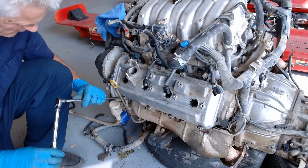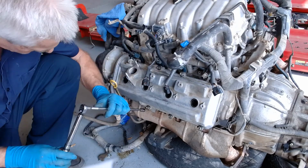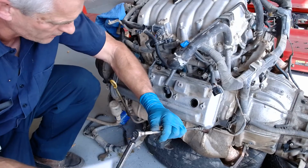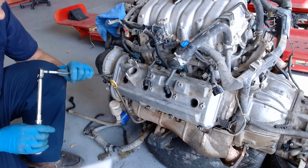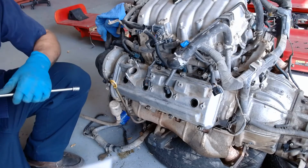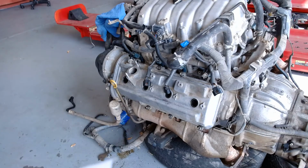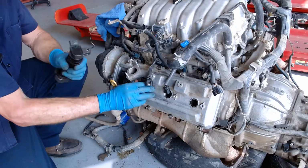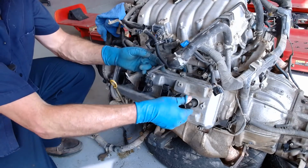So I have to do them again, to make sure they're all there. You can hear the click of the torque wrench. And I'd already put new plugs in. So now I'm ready to drop my coils back in and be done. There's one. Each has a seal. There's the other one. There's another one. And there's the final one there. Get my bolts.